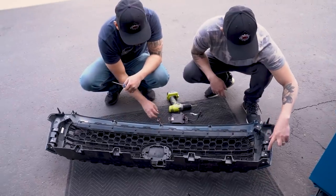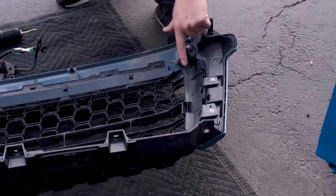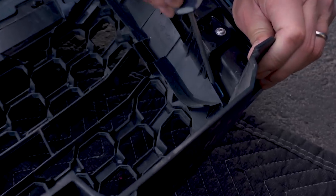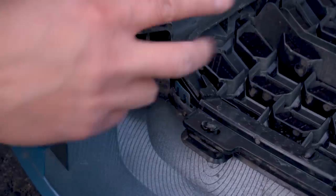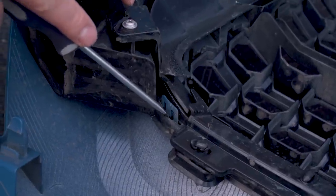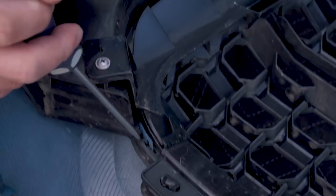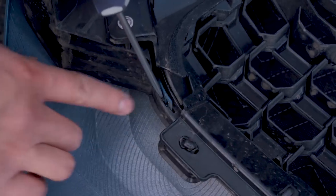So there's a total of four screws on each side, but the outer two are the ones that we only need to take out. The inner one looks like it just holds this extra bracket, so we don't need to do that. Next, I think we just need to pop it all out. There's a tab — pretty normal tab — just push it in with a flathead and then push down at the same time and it'll pop out. These tabs on the very bottom look like they have a split type of locking holes. On the back side there's a little lip, and on the tab itself there's a tab on the upper side. So what we need to do is pretty much break that bottom side, which is on the OEM old grille that we are not going to be using anymore, so that's completely fine.